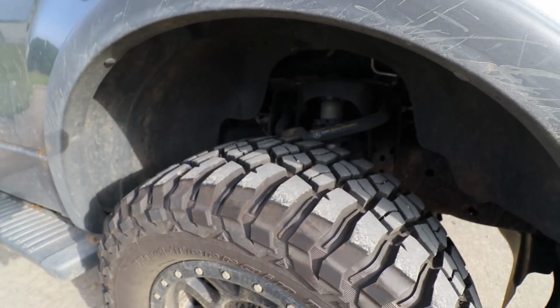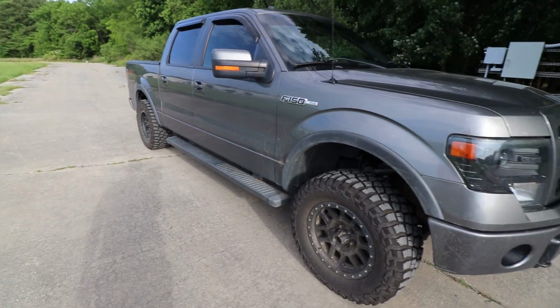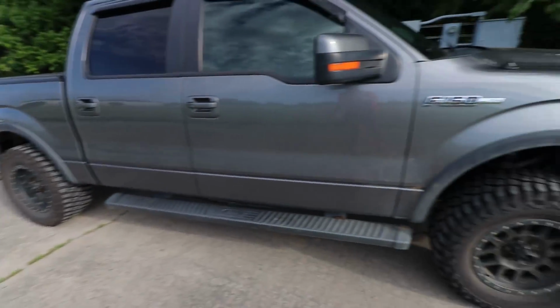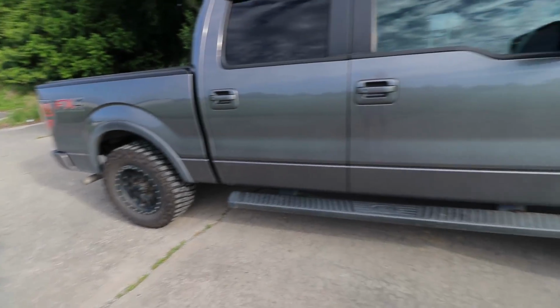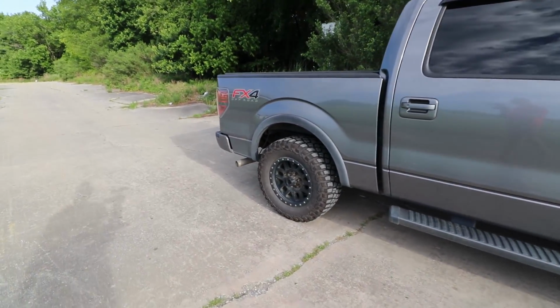Now, suspension lifts work by actually adding taller suspension to your vehicle. This can be done a few ways depending on how much money you spend on the kit. For most pickup trucks, your base entry-level kits, a lot of times they'll use the stock shocks and struts, and they'll just have taller spindles on them, and then maybe a lift block for the rear.